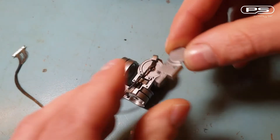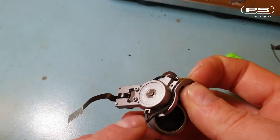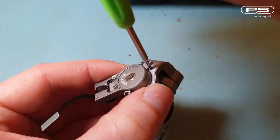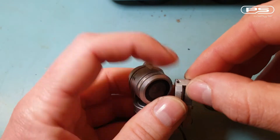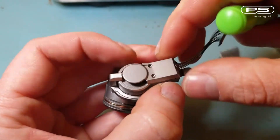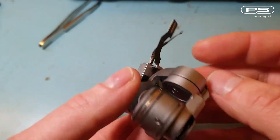Back to the camera signal cable — I'll slot it into the channel of the roll motor cover and refit the cover. This leads me to the yaw, where the cable also sits in a dedicated channel. I need to leave enough slack so that the yaw motor can operate without pulling on the cable. Once happy I can fit the cover back on. The cable fits into the channel there and the little shell makes it stay in place. Let's fit the tape back on as it was, straighten the signal cable and fit the last motor cover. Some of these parts aren't in the best shape, but I'm not too bothered about aesthetics at the moment as I can always come back and replace them once I know everything is working. So a bit of tape will do for now.